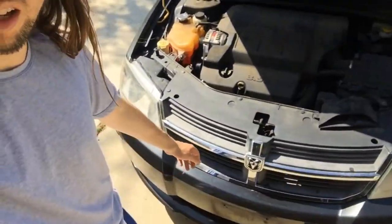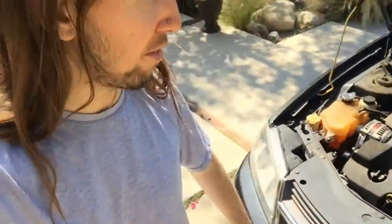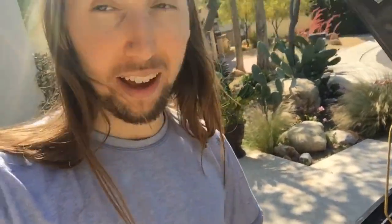I don't really want to remove the grill to do this — I'm just going to do it while it's on the car because there are a lot of little components I would have to remove, and these little plastic clip things I always break when I try to take them off. So I'm just going to leave everything. The first thing you want to do is wash the area that you're going to Plasti Dip, because you want to make sure the Plasti Dip is bonding to your car and not to little pieces of debris, just to make sure it stays on and looks flat and even.